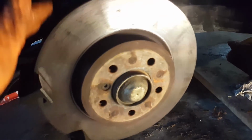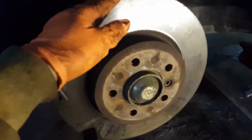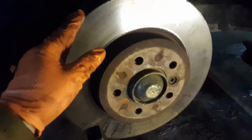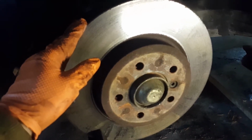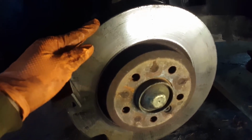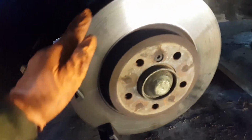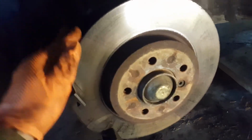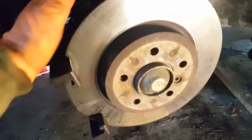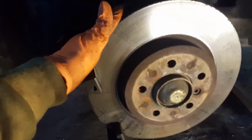Typically when a wheel bearing goes bad, one symptom is it has a sound, because the little metal balls inside are crushed, or the mounting assembly holding the metal balls is broken, so that it directly causes the balls to shift. When you turn the disc, the bearing inside turns and makes a noise, especially when you do a 360-degree turn. Sometimes the faster you turn, the louder the noise is. So that is another possibility causing the wheel to be hard to turn or seize.